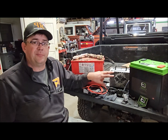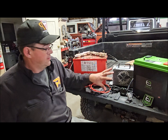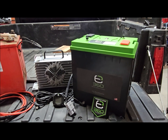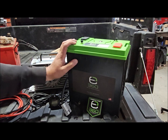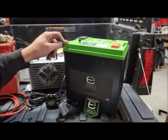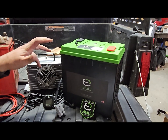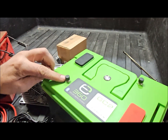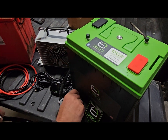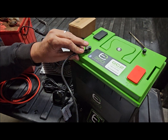I'm going to go over some of the components and specs of the batteries we're taking out and putting in. Here on the tailgate of the Polaris Electric Ranger, we've got the components we're putting in. We've got the Xpeon 360 48-volt golf cart batteries — we're putting six of these in. A couple of really cool features: these little posts here are CAN bus connectors, and each battery comes with a CAN bus wire that plugs in here and links it to the next battery.